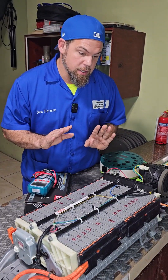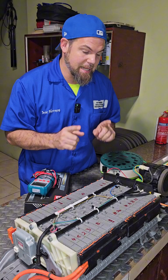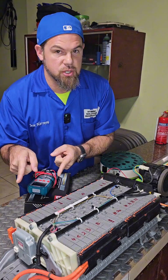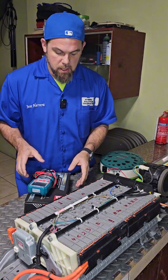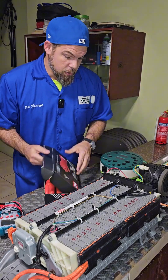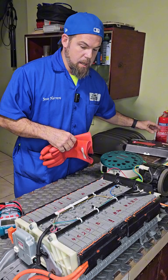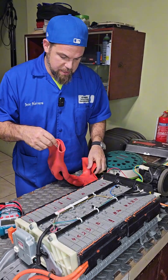There is a very easy method to detect if one or some of the modules are giving trouble. In this case, we're deep discharging or deep cycling the battery. All we need is a CAT4 multimeter and our safety gloves, because we're going to do high voltage measurement.